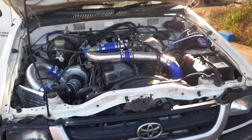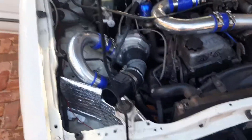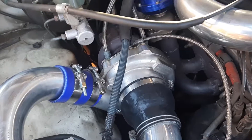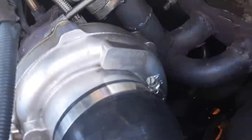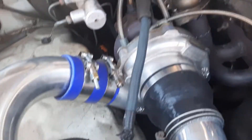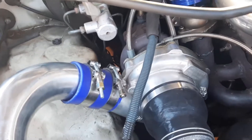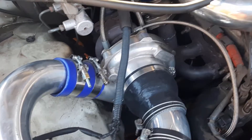It's probably what got me my job. The main eye-catching thing is this - a $200 knockoff of a Garrett GT3076. It's 60 millimeter diameter on the major of the exhaust side and 76 millimeter on the major of the compressor side.